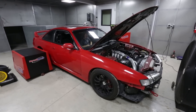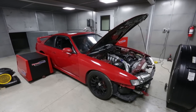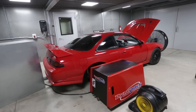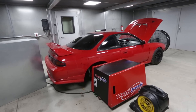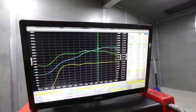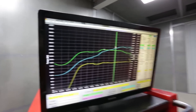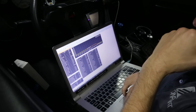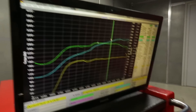I'm sure you're wondering about that knocking noise — more on that later. Now onto the full throttle pulls. We've been making a couple of pulls here trying to get back to where we were before, and it looks like the car is making the same amount of power, but we're running into a weird knock issue. Sasha hasn't put much timing into the engine at all and yet it seems to knock — at around 11 degrees. You'd normally be able to run 15 or 16 degrees pretty easily, so that's bad news for us.